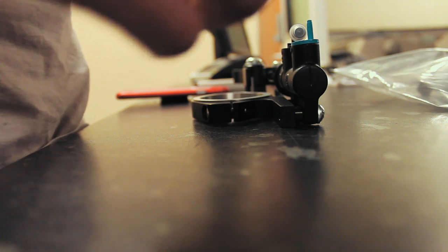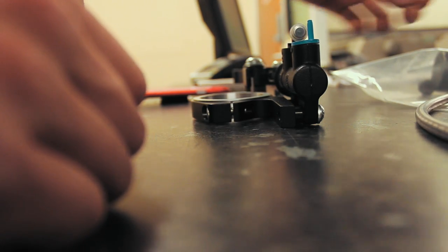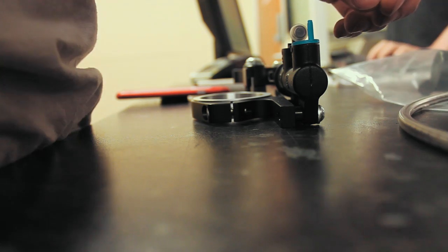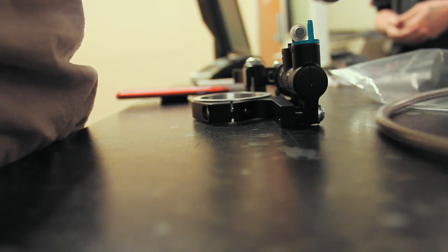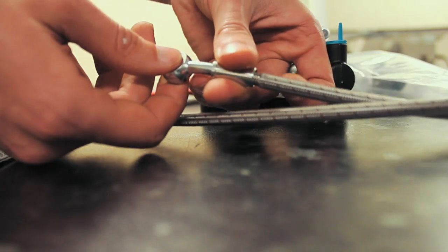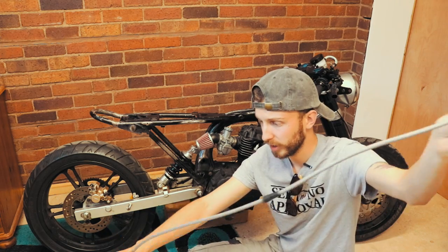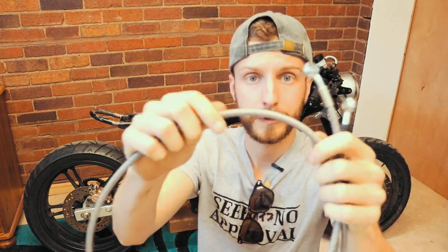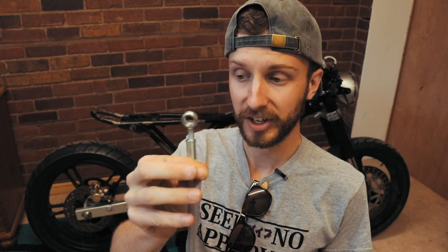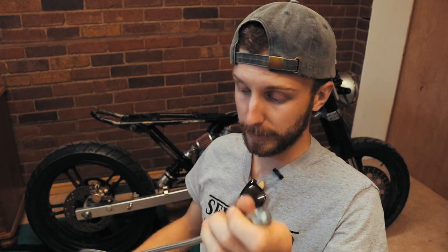There's one that's half done. So that's quick — yeah it's easy, just squeezing an end down. All you need to do with this is put some masking tape on it and put a line in the direction that it's going. If you feel you need to change the angle of the fitting, leave it loose, choose the orientation of it and then they'll crimp it for you. So we are back and we have one long brake line. I went for a clear coated nylon line — a flat end at the master cylinder side and a curved one at the brake side. I'm going to start from the brake side, bolt that down, and then follow it along the frame all the way to the handlebars.